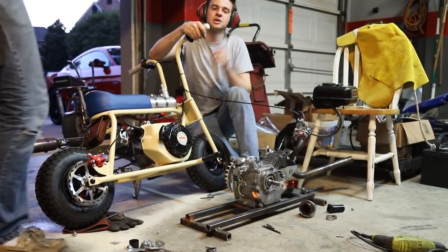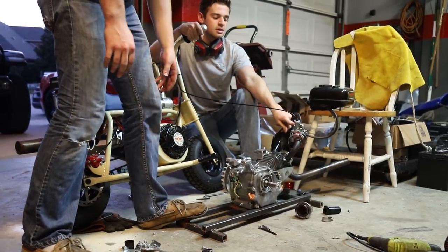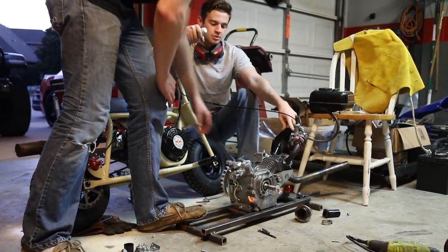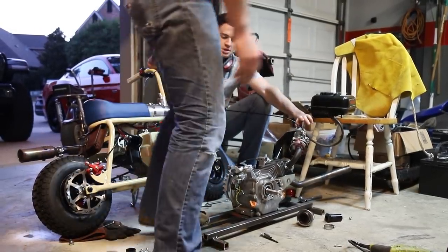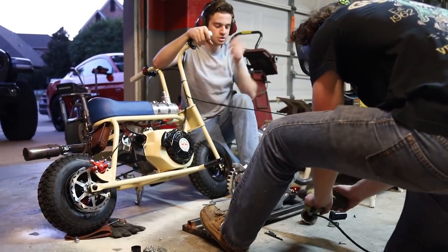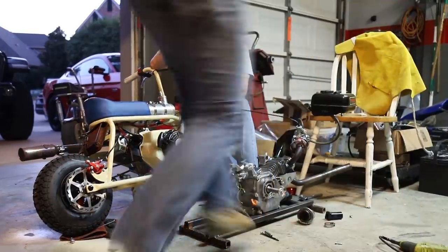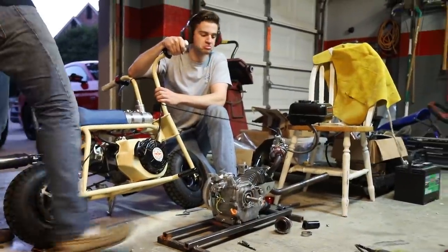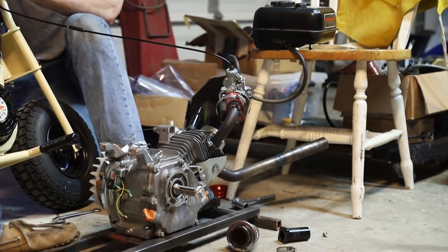Yeah, so it likes to choke. Also, this Mikuni is shooting so many flames. Well, yeah, this Mikuni is meant for the little rascal, which has a 225 tillotson. That's true. So it's definitely not jetted, right? All right, ready? All right. Yep. I mean, she's not happy, but she runs.